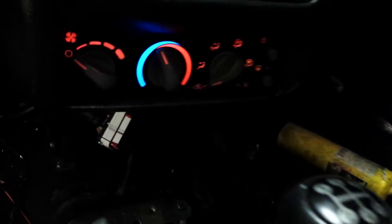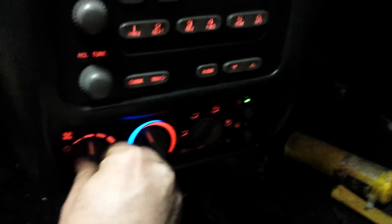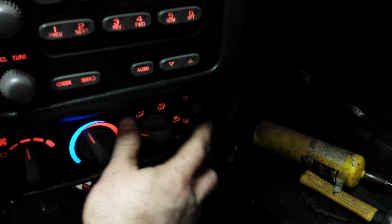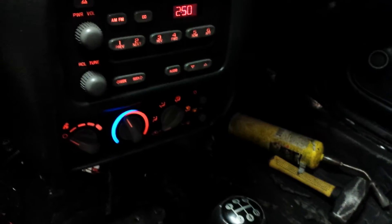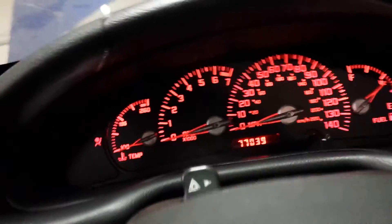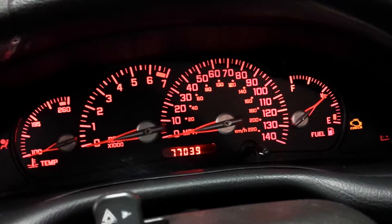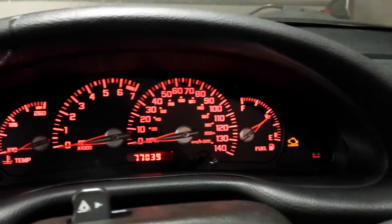The factory radio works. I've done an LED upgrade to the HVAC. Defrost and air conditioner are both working — obviously there's no air conditioner in it right now, but I've tested the pinouts with my voltmeter and everything works. I even managed to figure out the mileage issue with the Canadian clusters — I found the programming, was able to modify it, so I now have a US spec 140 mile-per-hour cluster in my car.